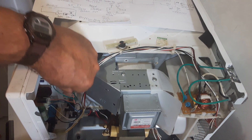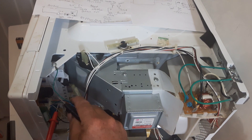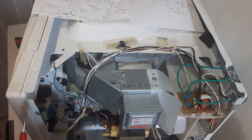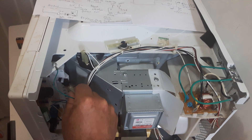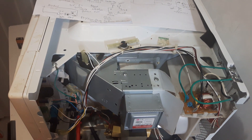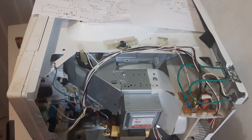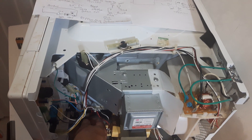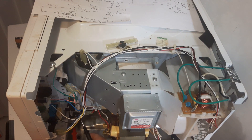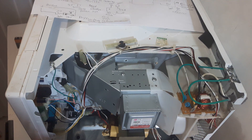We're going to check the switches. I'll take this one off here — this is the top switch — and just make sure we've got continuity. We've got continuity there, so I'll plug that back in. The middle switch, there's no plastic holding it so you can just check it directly — that's good. And the bottom switch — the bottom switch is the one that goes most often. So all three switches are working.